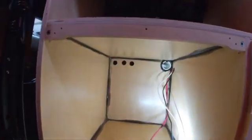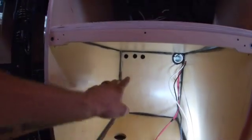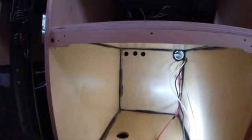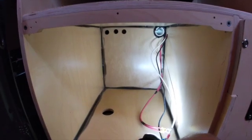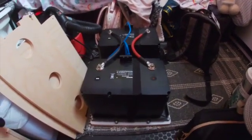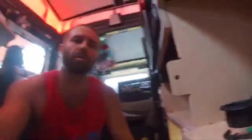Down below I yanked out all of my batteries for the time being so I can get in here. You'll see in the back I drilled three holes. Now, this trailer comes with lead acid batteries, but I have upgraded — they're sitting right here. I got Renogy's smart batteries, 100 amp hour lithium, so you don't have to be concerned about venting — that's something for lead acid. That's why it's all sealed.